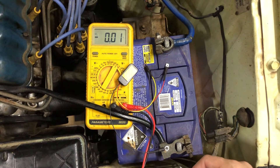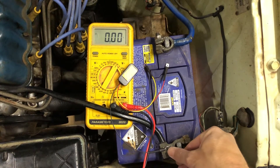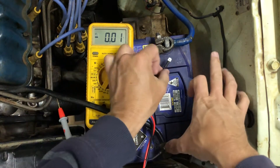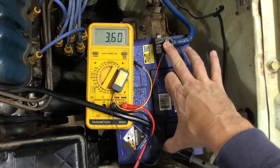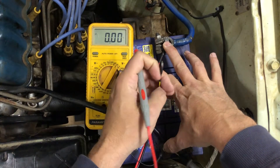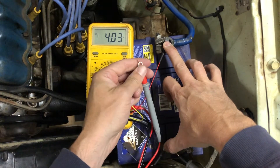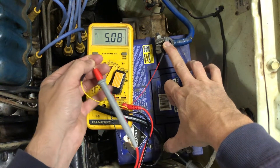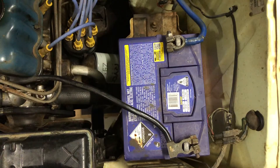Just to confirm that this new digital voltage regulator is working as I expect, I will put the ground of the voltage regulator on my battery, put the positive on the 12 volts, then I've grabbed my multimeter probe and I'll put it on the yellow output wire. We can clearly see that this new digital voltage regulator for the instruments is putting out just over five volts.